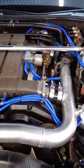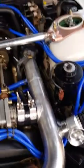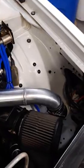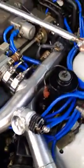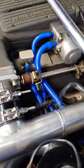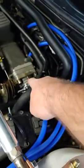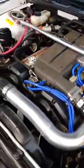I've got the Turbo XS HKS really loud blow-off valve, so it definitely shoots out a lot of air. We'll start her up in a few minutes and check it out. Basically I've got 2.25 to 2.5-inch couplers — a straight one here, and here we did a 90-degree bend, so that's a 2.25 to 2.5-inch 90-bend. It's 2.5-inch piping the rest of the way all the way through.